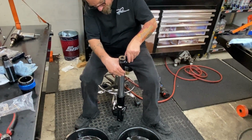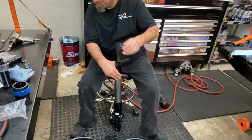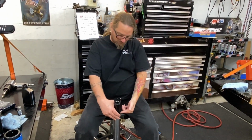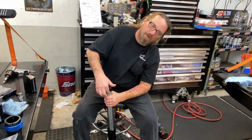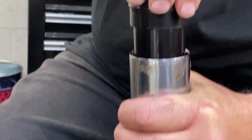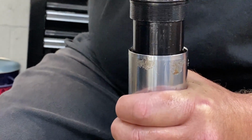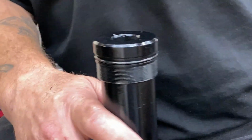So when you go and put that on the press, what's that? Presses it down, gets all the spring. It compresses the spring. So I can start the threads between the fork and the threads. You've got to compress this down so we can thread it in. That's right. Two ways you could do it. You could hold this up and try and push down and thread, or I could bring it to the drill press and make my life a lot easier and work smarter, not harder.